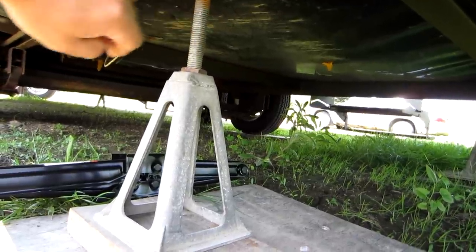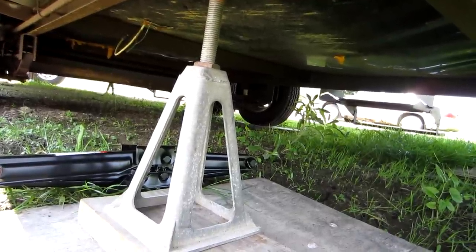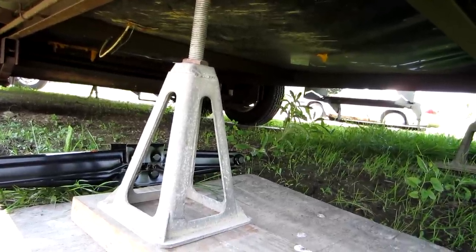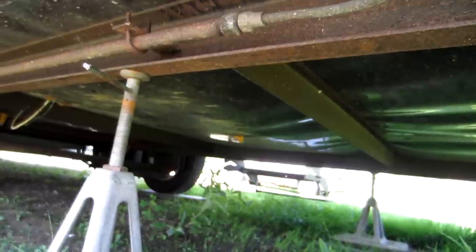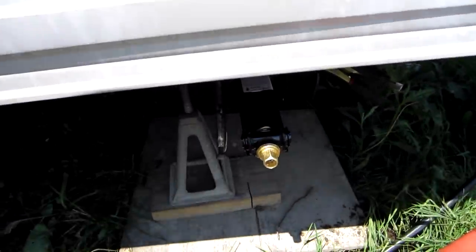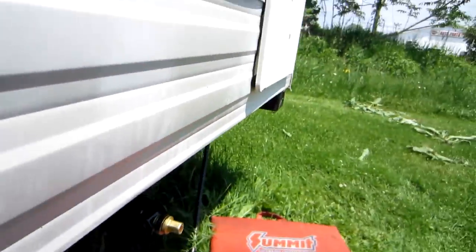You can see where I normally put our jacks and they do a good job there, but if I can get the jack a little further back in the corners, the camper should be better stabilized overall. What I'm going to do is take this jack, position it on the cross member like I want, and use vice grips to hold it in place. That'll also let me show you another consideration when buying jacks: how long the jacks are when they're fully collapsed. I have this jack positioned and held in place with a couple of vice grips — you can also use C-clamps if you don't have vice grips.